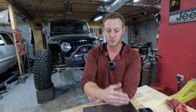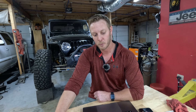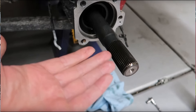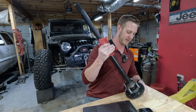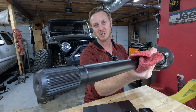When you start running forties and want to rock crawl — especially if you're heavy on the gas pedal and like to bounce it up the trail — you know what you're asking for. He points out that the shaft tapers down right at the splines. I do see that, but I believe this isn't a bad thing — what we're really looking at is the fact that they've thickened up the middle of the shaft much more to help make it more stable. My 10-factory Chrome Moly aftermarket 32-spline shaft also tapers, and it's actually quite beefy.